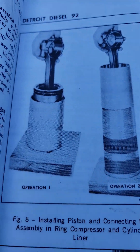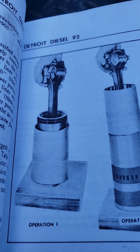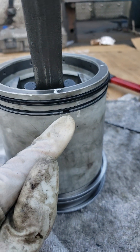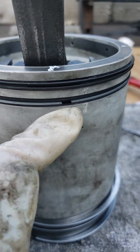I was saying in the book it's saying to do it this way. And with most piston jobs, I would definitely agree. But for this guy, as I mentioned earlier, the springs behind these oil rings are popping off so easily and they're overlapping. I'm finding them.